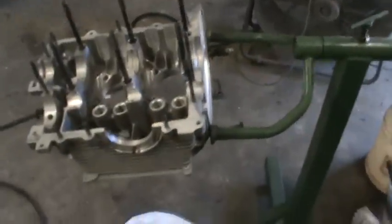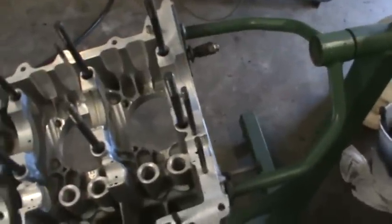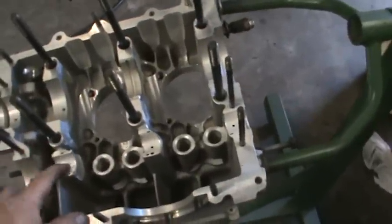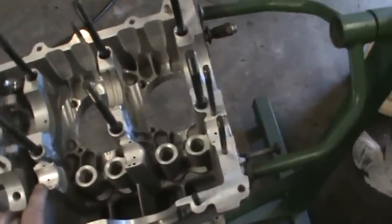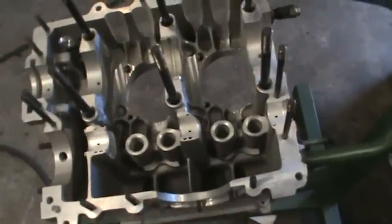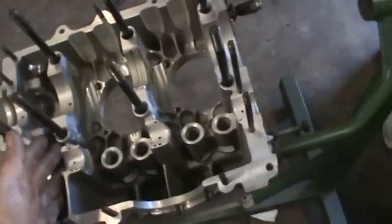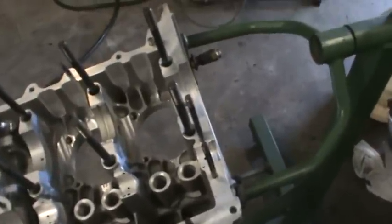I pulled the crank back out. We're going to drop it back in here in a little bit. I'm going to finish grinding this cam, and so we got the lifter bores prepped. We got this bearing cut, which I'm probably not going to use. I'm going to try to find some different bearings. These are very lightweight, and I do save the old ones because I like to do a double thrust. Not really necessary with the straight cut gears, but we'll probably do a double thrust. It's going to be getting beat on in this motor, so we're going to make it as strong as we can.